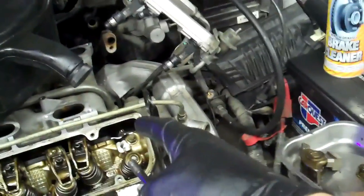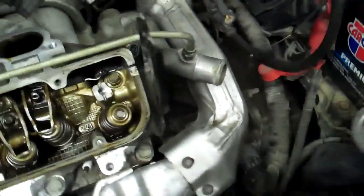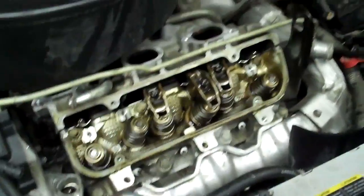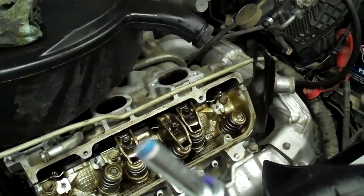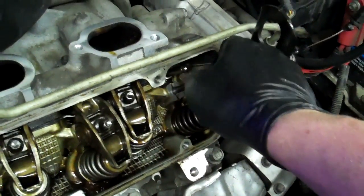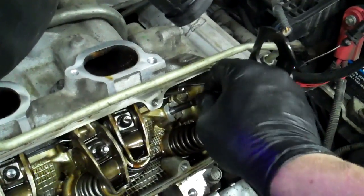See how it's gone — it's down in the bottom now. These bolts traditionally have a little unthreaded portion that sticks down a bit, and I've got a tang in the bottom of these holes now. I don't want the bolt to not tighten down properly or bind on that. So I put those on the bench grinder and ground them down to where they'll tolerate having that set in the bottom. I couldn't pull the tangs out with a magnet because they're recessed. So I'm just going to leave them in there. Don't twist off the tang with the tool — turn it 90 degrees so you're on it sideways and give it a little crack with your ratchet handle, and you'll be good to go. Now when you look at these, I've got threads again.